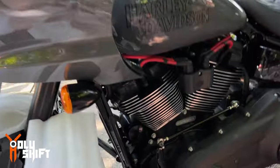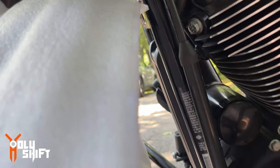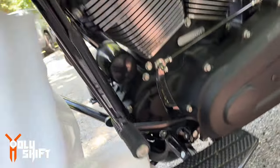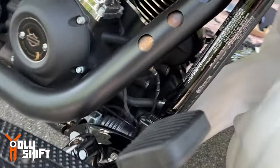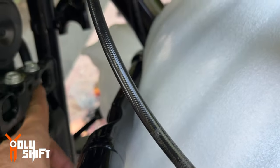Hard lesson learned. Don't try to put the top on. It's tempting to put the top on first. Align the bottoms. Put the two bolts on the bottom. Get them tightened initially, both sides. Right there. Once that's done, now you go to the top and hang it from here.